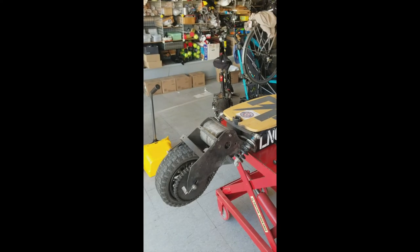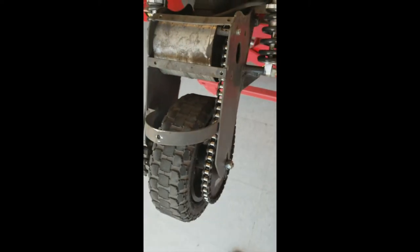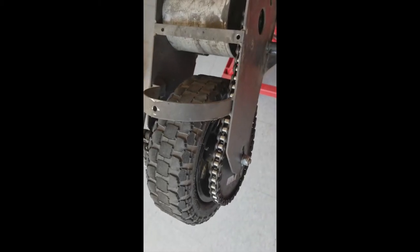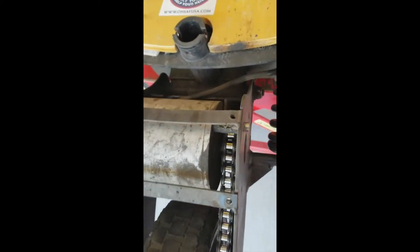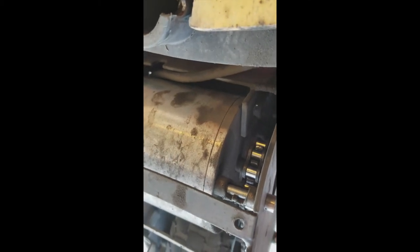This right here is my 1500 SuperTurbo brushless lithium. This is the rear mechanism, and I also have the rear and front sprocket and the roller chain upgraded to number 40. Here you can see what happened when I put this mounting screw down in the original position — the chain essentially ate away at the spacer right there.